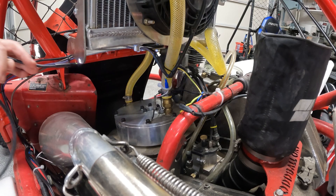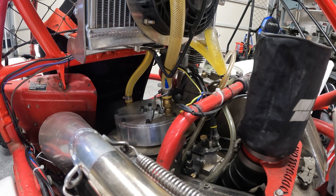We'll see more obviously when it's torn apart, but clearly the failure happened around here — probably the exhaust port, the exhaust bridge actually. This is one of those known things: you need to remove some of the exhaust bridge material. Because as the engine warms up and gets hot, that little section of metal expands and can impact the piston. I'm not saying that's necessarily what happened in this case, but it's one of the things you can address during the rebuilding process.